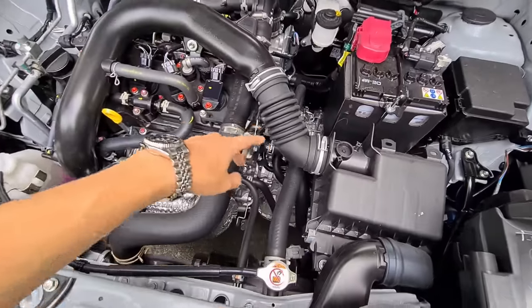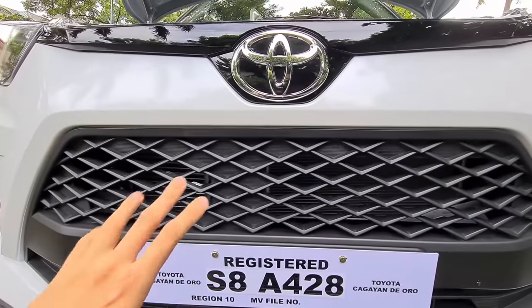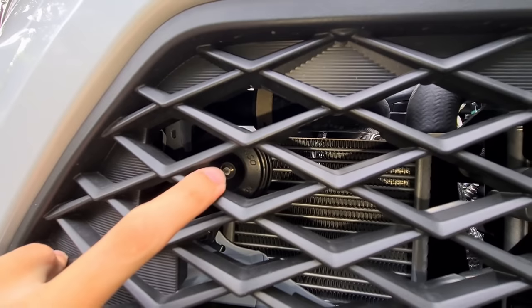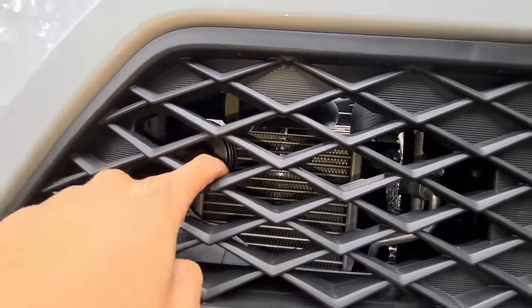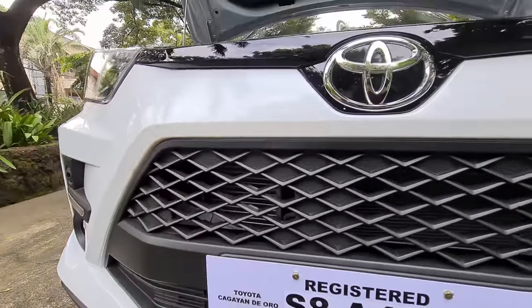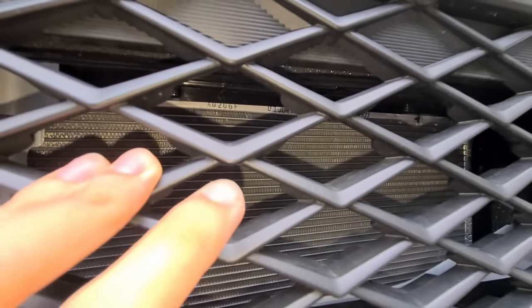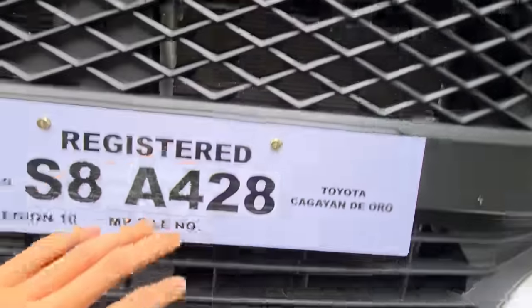You might notice there's no undertray covering the belly of the engine. After driving it for a while, I realized the engine bay can get very hot because of the turbocharger, and there's no space for heat to escape when the hood is closed — the hot air exits below the engine bay only when you start moving. Also, looking at the front grille, the horn is placed on the left side blocking part of the intercooler. My plan is to relocate it behind the open area on the right so the intercooler gets more airflow, where the radiator is located.